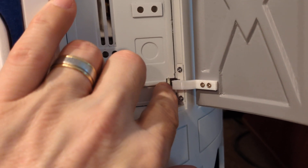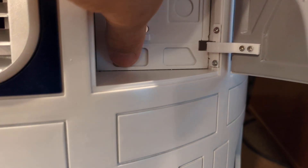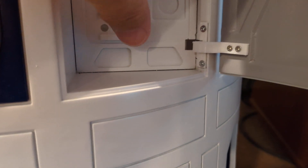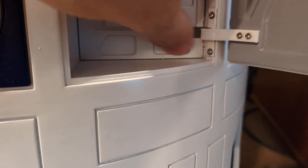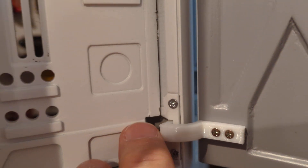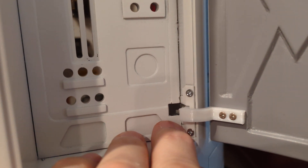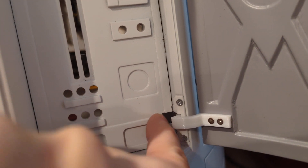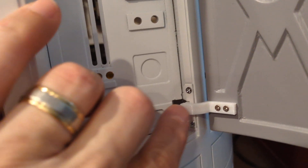I did manage to get the hinge blocks in without ripping this out. I found that I had to enlarge these openings just a tad. You can see just a very thin black shadow down there — there's a very thin gap where this piece isn't quite all the way down. It's like 99.9% as far down as it could go, maybe a fraction of a millimeter short. Maybe it could have gone further down if I had sanded the bottom of this piece. But what that did was it made this opening a bit too small for the hinge piece — it was interfering with it closing. I could also hear the back of this opening; it's got angled plastic and it was lightly scraping on the hinge.